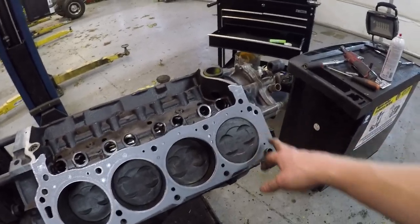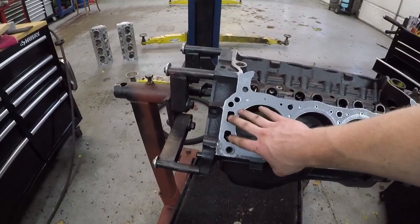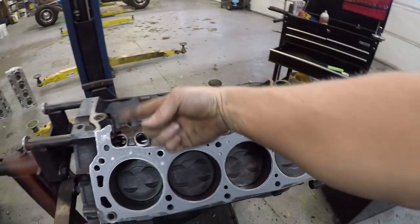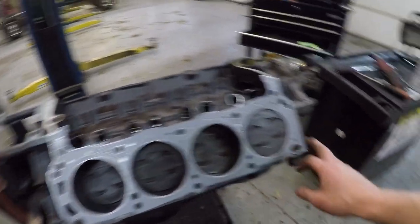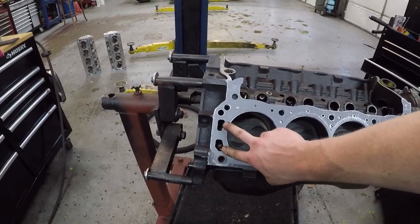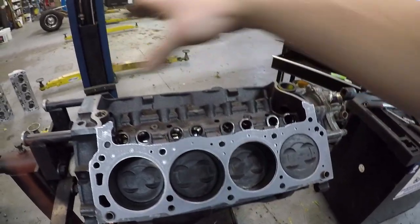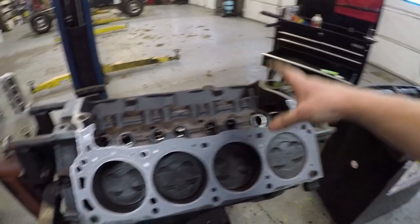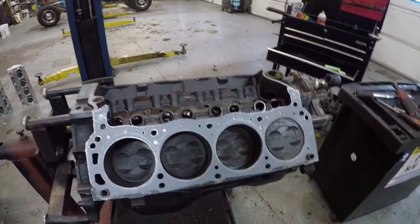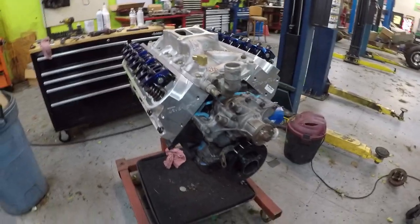Here's another little tip for you guys as far as head gaskets go: if you have a head gasket that doesn't say 'front' — like this one does — always put the big holes to the back. If the big holes are at the front, it's only gonna circulate water through the front side of the engine and the back's gonna overheat. Always put those bigger holes to the back because it allows water to flow through the heads and circulate all the way through the block. If you don't, you're gonna end up running those back cylinders hot and melting something down or burning up a piston.